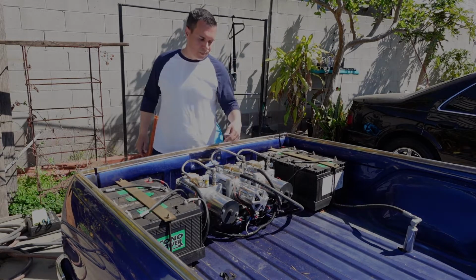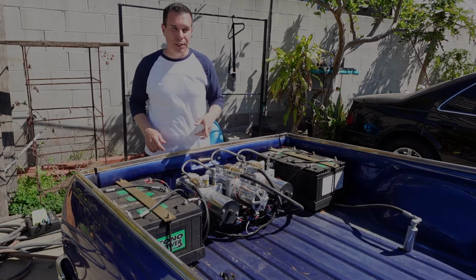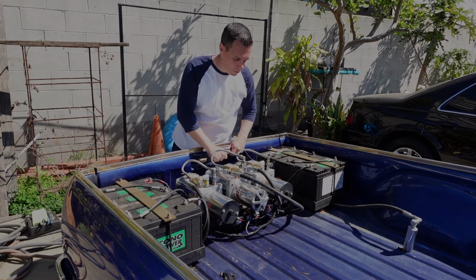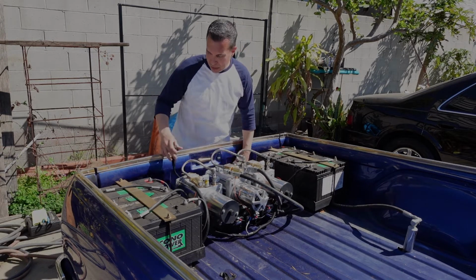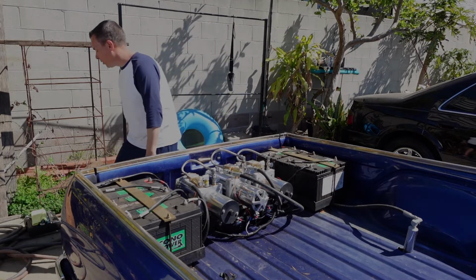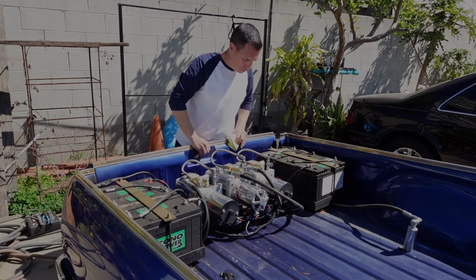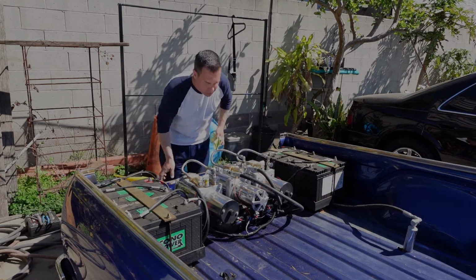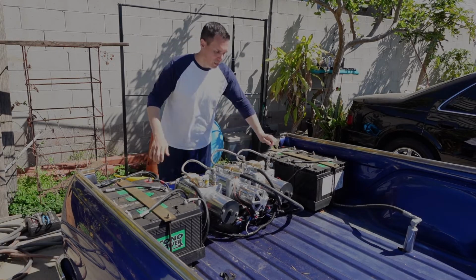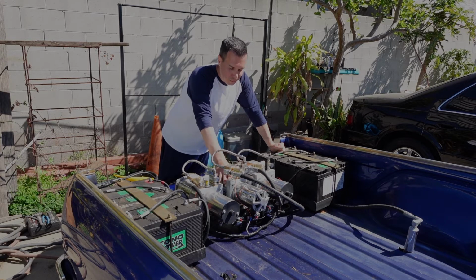Again, you have the motor and gear spinning, car's not lifting, so I'm assuming it's the same thing as last week, but again, let's open it up, see if it's the same or anything different. Again, before you work on anything hydraulic-wise, you always want to disconnect your batteries or disconnect your ground. Since I know I'm going to basically be swapping out, I'm pretty much going to be replacing this whole block.